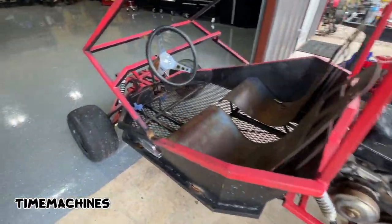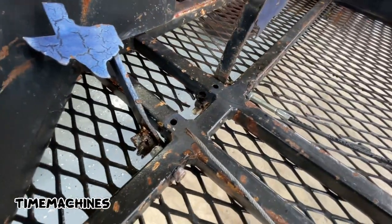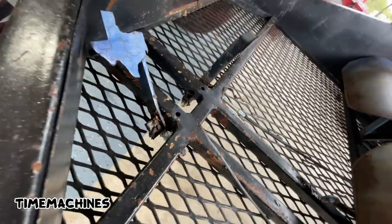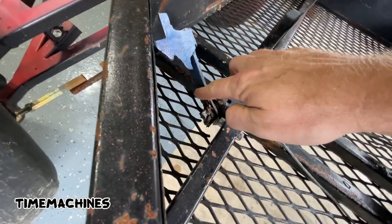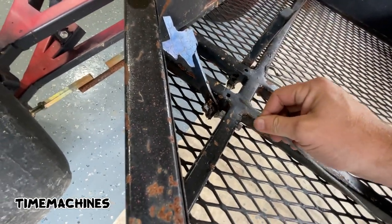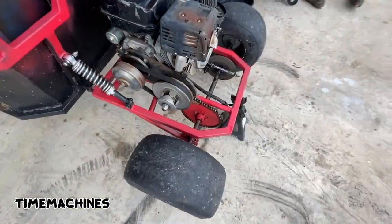The brake situation's a dire one, boys. David tried to kill me. Look, he cut my brakes, y'all. Sabotage. That's old as it gets right there, cutting brakes. So we're going to drill a hole in the side of this pedal, move this up further, put a bolt through it and a washer, fold it over and crimp it. And then they'll hang up nicely.